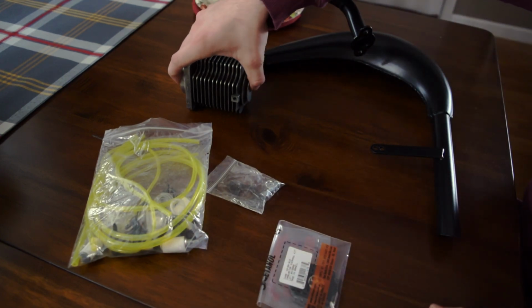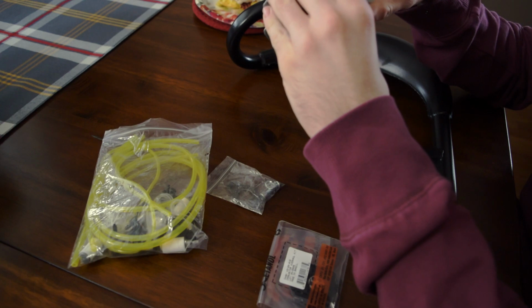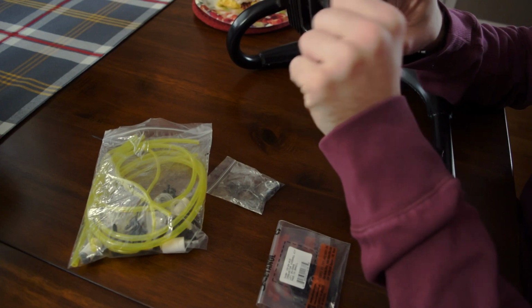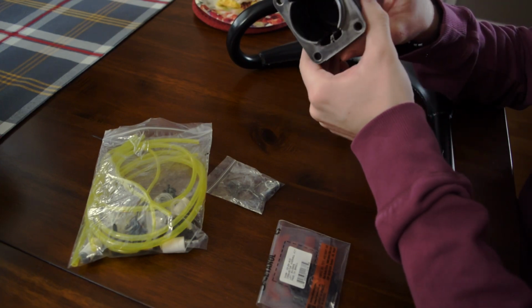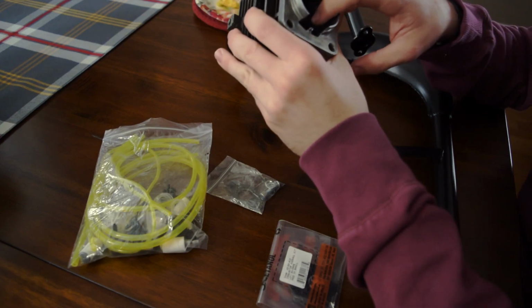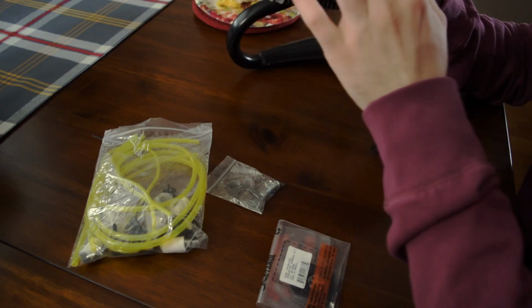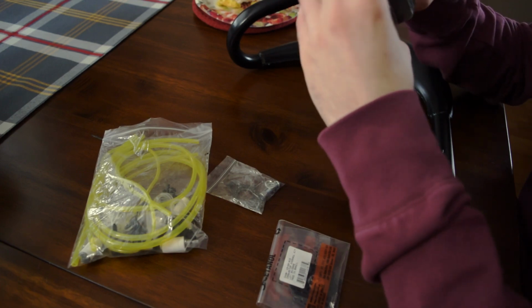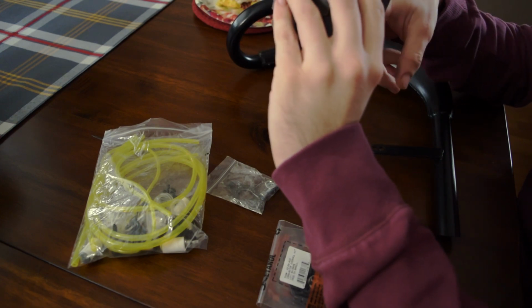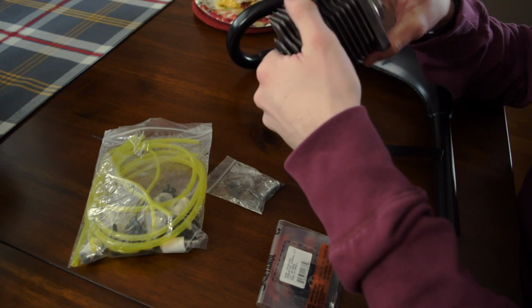The third thing is, if you watched the first video in the series, you know how I bought the 3 others, the Super XLs, and I took the cylinder off of one. This is the best cylinder that we've got. Cleaned it up a little bit. This is the one I'm going to be doing all the porting on for the XL12. And I still got to clean out the fins a little bit to help our cooling, but other than that, she's looking pretty good. Really no deep scoring marks that you can feel or anything. And so she's going to work out good.